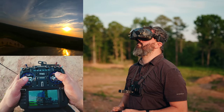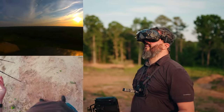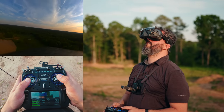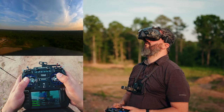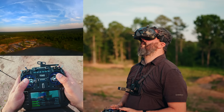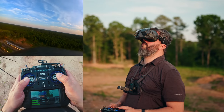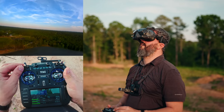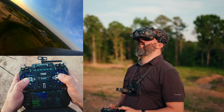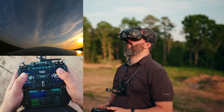The last flight I actually burnt out the motor and I haven't changed the powertrain a ton. It should be a little better on thermal cooling and it's a slightly lower KV motor, so I'm not crazy worried, but I don't want to hang out over this lake. I'm going to set it to what I think is a decent cruise speed and flip the switch to enable auto trim. Auto trim takes an average over a couple of seconds of the trim required to hold it nice and level. I'm going to try to disarm the aircraft in flight in order to save that auto trim.